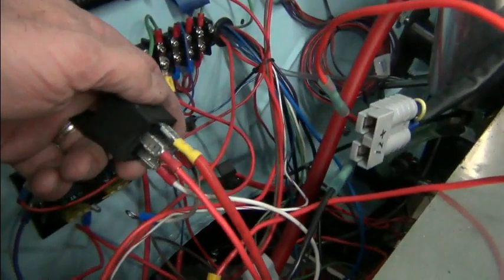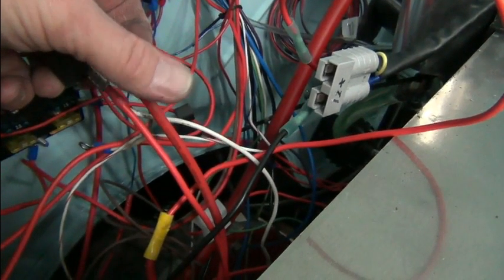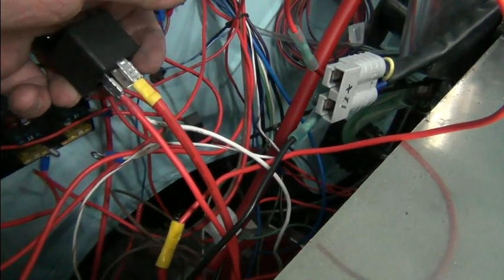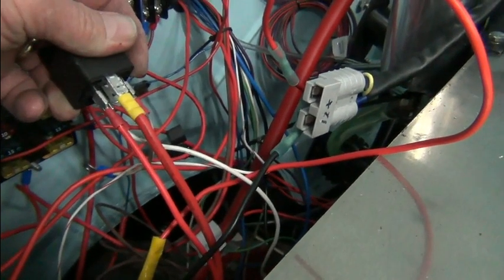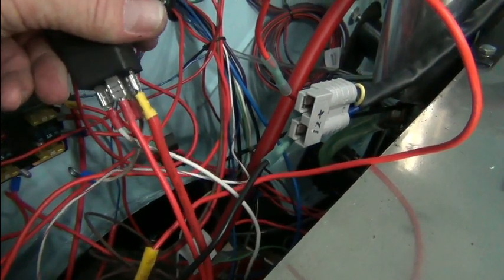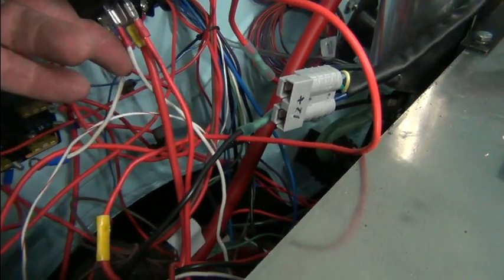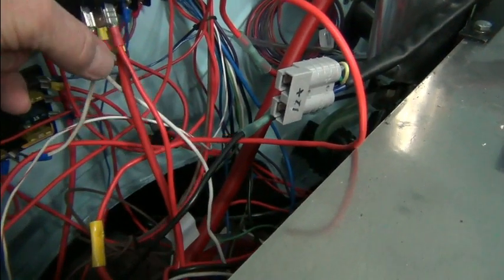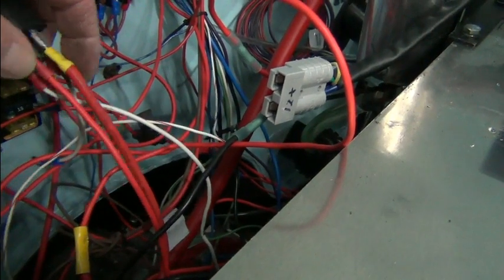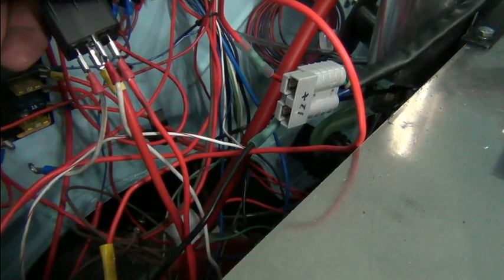and look at that. Here's another example. So look at what gauge wire we've got going into the DC to DC converter. Okay, it's coming out of the normally open contact on this relay, and here's the common, and look at the wire on the common. It's like a 14 gauge wire, and this is a 10 gauge wire. Not the way to do it, folks.